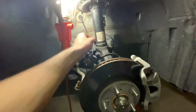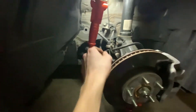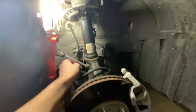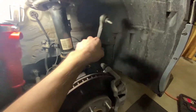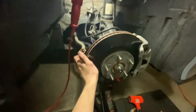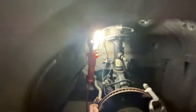On this wheel I've got those bolts taken out so the lower control arm is free. The strut is still in there, but I've got the brake line thing that connects to that off, I've got the bolt in the back off, and the tie rod link thing. I'll probably set you guys up for a time lapse and then get in here and try to get the strut out.